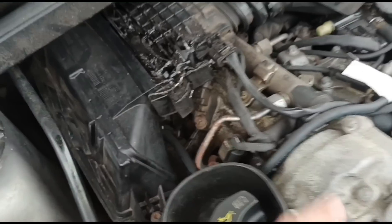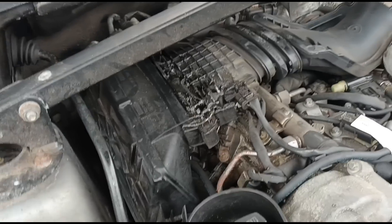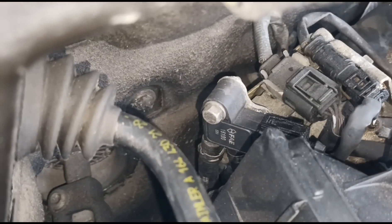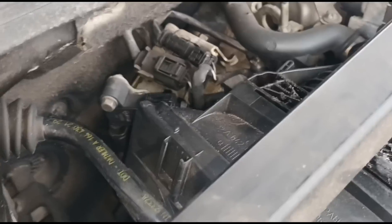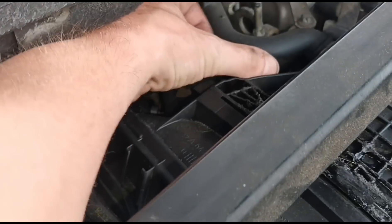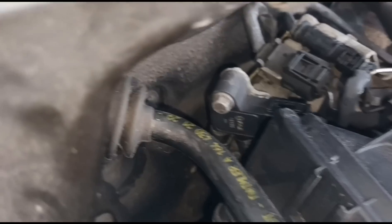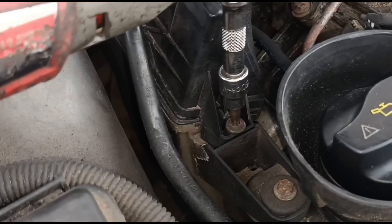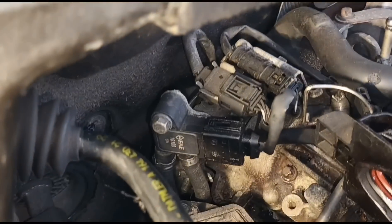You can see there are visible signs that it had black soot coming from the injectors. The differential pressure sensor is just down there and it doesn't look original to me. I'm going to get the airbox out of the way - it might be a little bit easier to reach. It's got two T30 Torx bolts on each side.